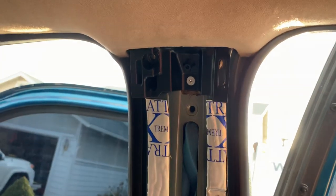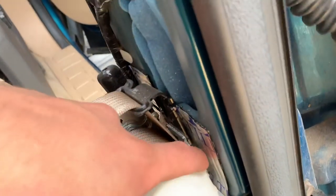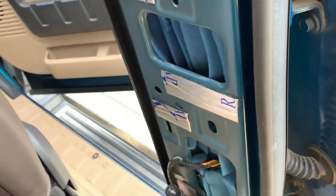For the lower part - the 6.7 seat belts plug right into my 2001 ones, so you don't get an airbag light. They bolt right in; I think I just had to drill one hole for the seat belt pin to go into the cab. You can see this is the foam deadener I have in all the pillars - anything to help make it quieter. I have a little bit of spray foam here and there, not much, just a little bit, and then deadener everywhere else.